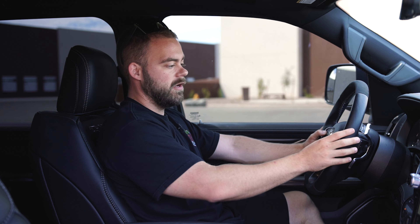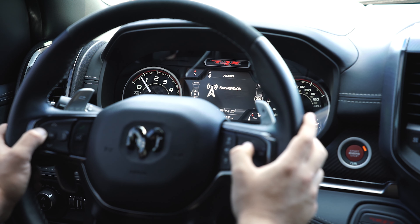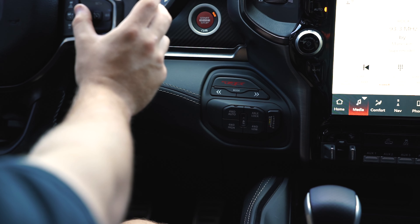Let go of the cancel button — now you're in the TASER system. Very important: make sure you keep your left d-pad button held down through this whole system. You're then going to use the cancel button to cycle through all of the TASER features until you get to 'Force Rear Wheel Drive.' Then click the cruise control on button — the center button — and it will activate. You know it's worked when your auto four-wheel drive button starts flashing. You can then let go of the d-pad and you've got a two-wheel drive TRX.